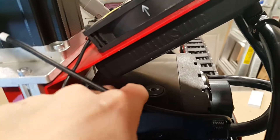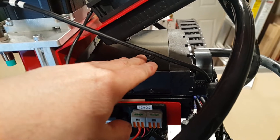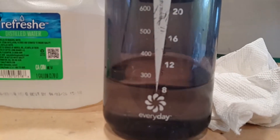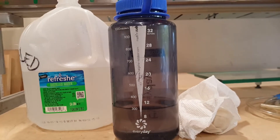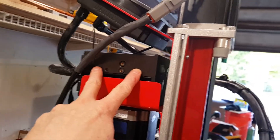I also took off this cap to make sure that when the fluid entered the reservoir, I would at least know about it, and then I kept a little tray underneath so that when it finally dribbled out, I stopped. The total volume came out to somewhere between 700 and 800 milliliters of water into that system. It's not too big — it's this 5.25-inch drive bay type reservoir, and then tubing.